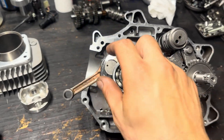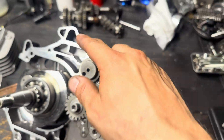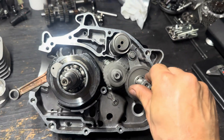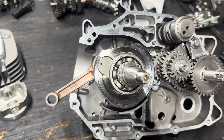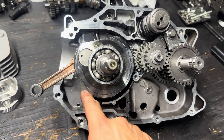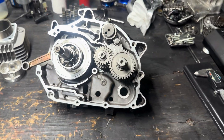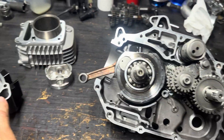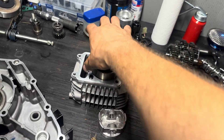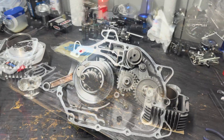I got the new crank in and the new five-speed transmission installed. The kit comes with literally everything you need — you just gotta put the arms in the right position and that's it. This is the crank: it's a longer reinforced rod, three millimeter stroker, already balanced for the stroker. I'm just gonna put some RTV around here, close the bottom end up, and then start doing the top end — put the piston in. I'll show you guys the flanges I had to get to space it out for the stroker.